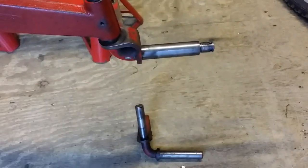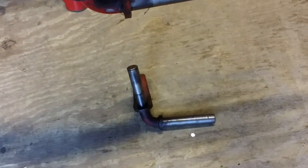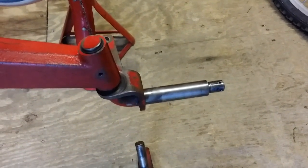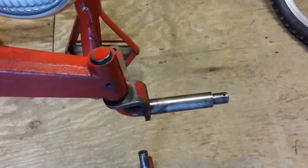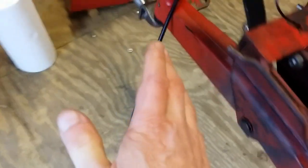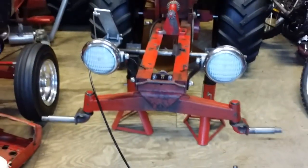So you can see the difference — we're increasing the spindle diameter to one inch. Instead of just having standard roller bearings on the 857, we're going to the one-inch tapered roller bearing, kind of like a trailer style, which is a 520 spindle. Everything worked out pretty well. There is a little bit of play in the one inch, so the spindle moves a little bit, but really nothing I'm going to worry about — nothing you would feel in the steering itself.